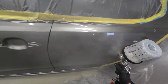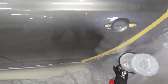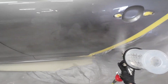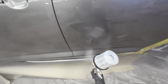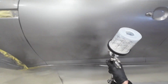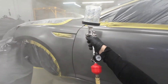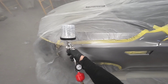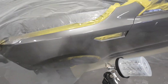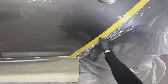Here are a few quick techniques for spraying clear coat. You want to always have a consistent speed — whether you're painting fast or slow, keep it consistent. Don't spray scared; don't spray super slow. Just a nice medium speed to start. You always want to be about six inches away from the panel. Different painters are closer or farther — six to eight inches — but just be consistent with it. You want to overlap 80%; overlapping your passes is important for full coverage and to allow the clear coat to flow out properly. Having your gun set up properly makes all the difference. My fan pattern and fluid setting are wide open, and air pressure is set at about 28 PSI. The best thing you can do is practice and experiment until you get comfortable laying down a nice, slick coat of clear.